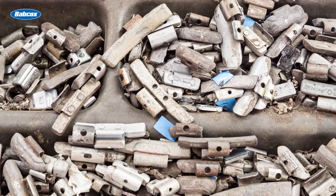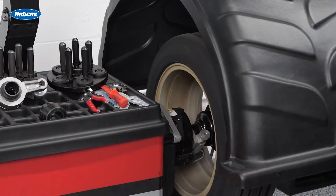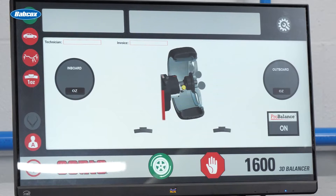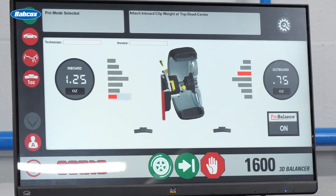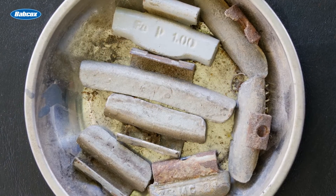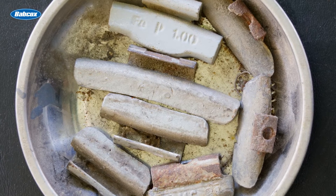If the weight falls off, your customer's wheel assembly could go out of balance. This could cause discomfort and annoying tire noise that makes its way to the cabin. And if a wheel assembly is out of balance, it won't run efficiently. With clip-on wheel weights, you might think, oh, just tighten it — it won't fall off then, right? Well, you're forgetting an important thing: extra stress leads to extra damage. Tightening clip-on wheel weights inflicts inherent stress on them, and you risk wearing them out even harder in the long run.